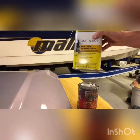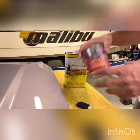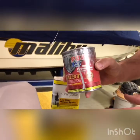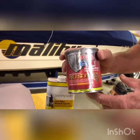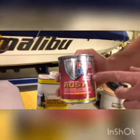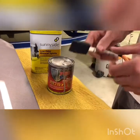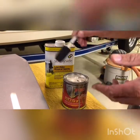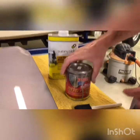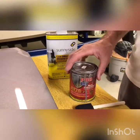So what you're going to need now: get your materials. You're going to need some mineral spirits or acetone — something to clean the metal with. What I like to use to seal it up is POR-15. You can get it in a couple different colors — I know black, gray, and this one is silver so it'll kind of match this hood. Then you're going to apply that with a foam brush, not a regular paintbrush.